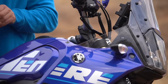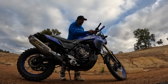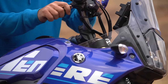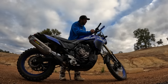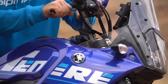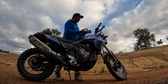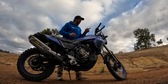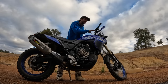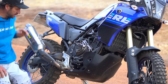Same thing again with the brake — exactly the same concept. Check all this because some people are heavy-handed at dealerships during bike assembly. Back it all off so you can move it. Do up the top one — your platform — lock that off with a little nip, and then the actual clamp, just go one, two — that's it. Ultimately you want to be able to move it. That's an ideal tension because it'll never move while you're riding, but if you bin it you've got a lot less chance of snapping your lever, and most importantly a lot less chance of breaking your master cylinder. That's big bucks.